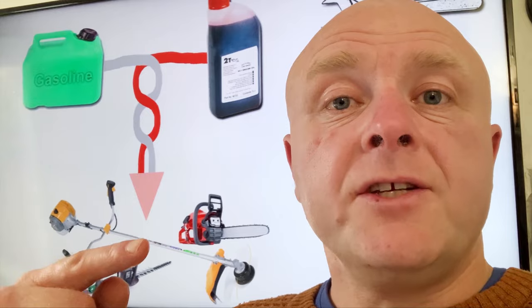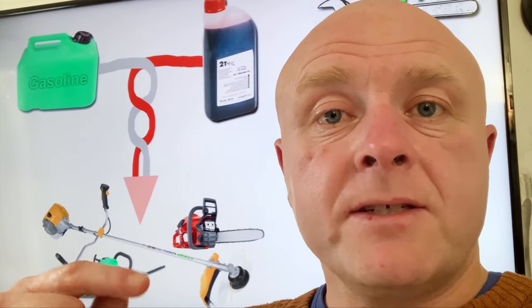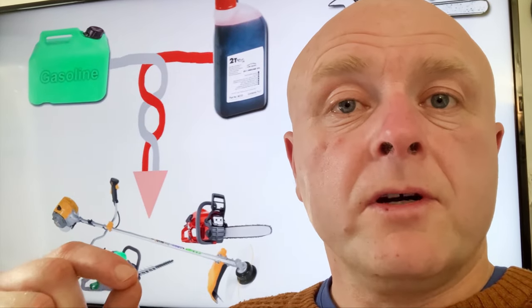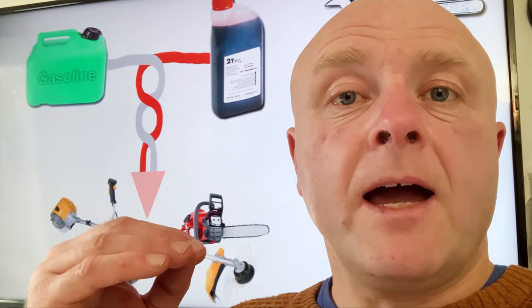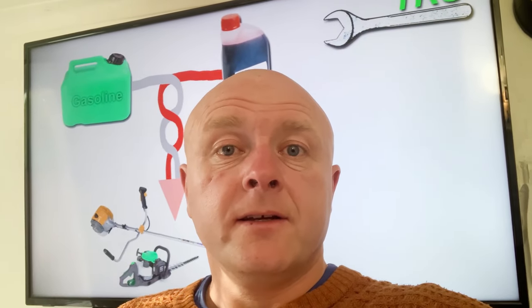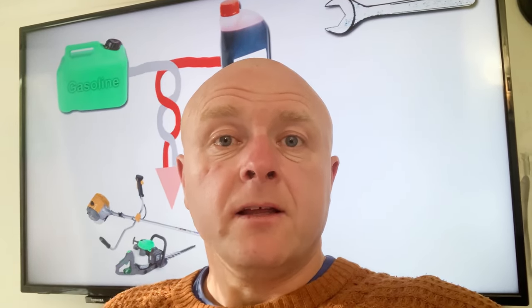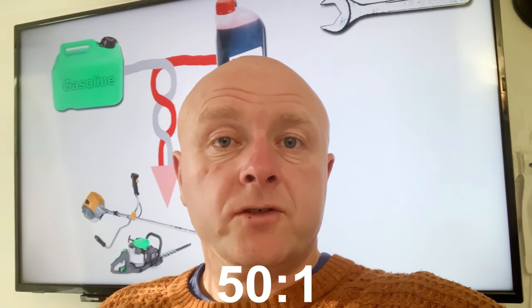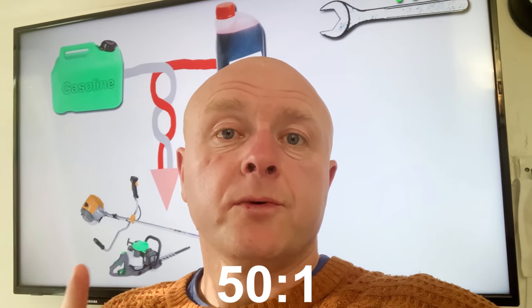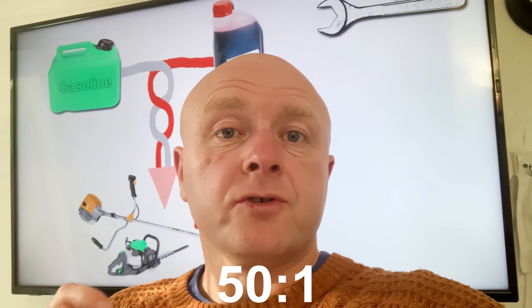At least with a little bit too much oil, yes, the running energy efficiency might come down a little bit, it might run a little bit warmer, and there might be a little more smoke — but we're not going to get this heavy damage that's seen through too little oil. That said, if I'm using a Stihl and I'm using Stihl oil, then I will use a 50 to 1 as recommended by Stihl, because I know I can trust those components within that machine, and I can trust that oil.